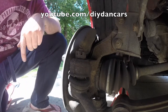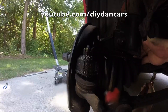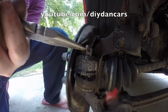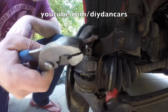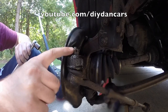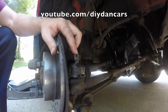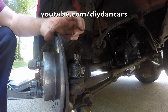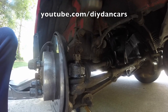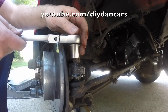All we have here is a nut and a cotter pin to remove. Got the cotter pin removed — success! Next, use a 17 millimeter socket to remove the nut. I'm going to leave the nut on here so that when I whack this tie rod loose with a sledgehammer it won't mushroom the stud. All right, we got the tie rod loose so we just have to remove the nut.